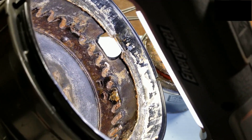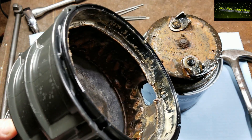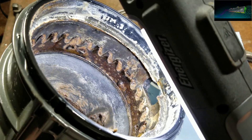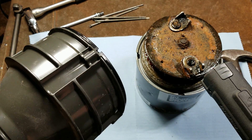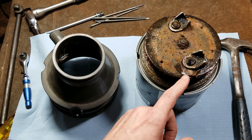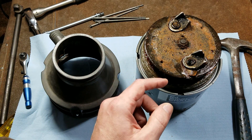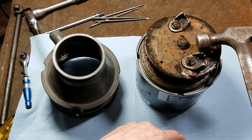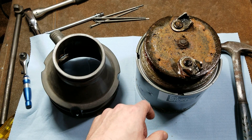This is just to show the inside. That metal band actually had teeth that were pretty well defined, and we can see how worn out they are — they're pretty rounded. But what's surprising is most of the tangs are still there; on really bad ones, all those teeth are ground off. Those teeth are what do much of the grinding work against the anvils, which are right here, or the grinding impeller. These little hammers here — which often get stuck, though this one's not totally stuck — hit and bounce the food around against the teeth. If it's too big to grind all the way, this little thing will rotate over, and then centrifugal force causes these to, once it passes over the piece of food, throw them back out, and they'll come around and hit it again and beat it into pieces.